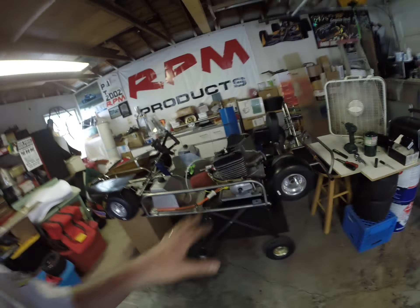Thanks to Steve, Fast Tiner — thanks Steve-O — he gave me the gearing. We had 14-73 on it with the big tires and a pipe, and it felt okay, but I really enjoy this Sportsman can. If you've been a Yamaha guy and always ran a pipe and never ran the Sportsman can, you need to try it. It is surprisingly fast. At Gingerman, the first three laps of that race I had tears — I was laughing so hard. Coming from doing nothing but shifting gears for 20 years and getting into a gas-and-brakes go-kart, that alone was pretty hilarious. It was good fun, and they run pretty damn good just with a non-tuned exhaust. Give it a try.